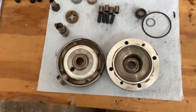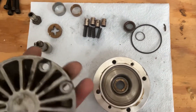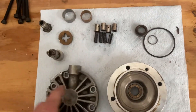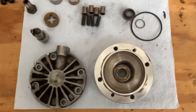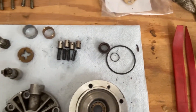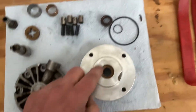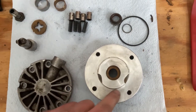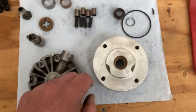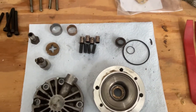I have another pump coming from eBay and I'm going to do a complete rebuild on this. This is the original pump and you can see the date stamp on it — week 9 of 1989. So this is the original pump from the car, 331,000 miles, and it just started to leak the last 25 miles or so out of the front seal in this area here. It was coming out here, going through the hardened gasket which was already soaked and dried out from oil, dripping down and losing fluid at a pretty big rate. We'll see how it goes.